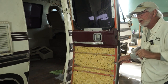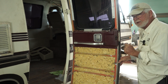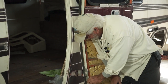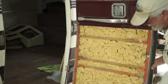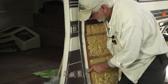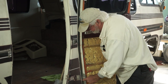If you find you have a problem, here's your fix. If you're painting it, cut it open, weld it, and put it all back in — because you're going to burn the paint if you do that with a nice paint job, so this needs to be done before a paint job. But say you can't do that. There's a metal plate here with two bolts into it, and it holds it tight. What you've got to do — aluminum plate — take the bolts out one at a time and put it in. I'd also recommend grinding off the heads of these bolts so when it shuts it won't have any bind. Just take the caps off them, give a little extra clearance so when it shuts, it shuts nice.